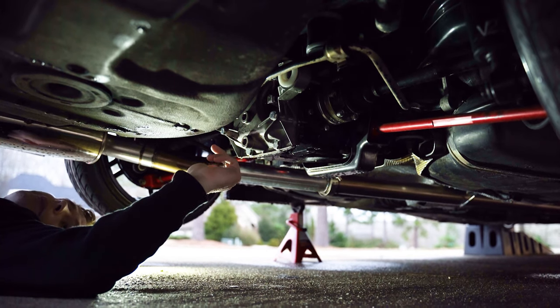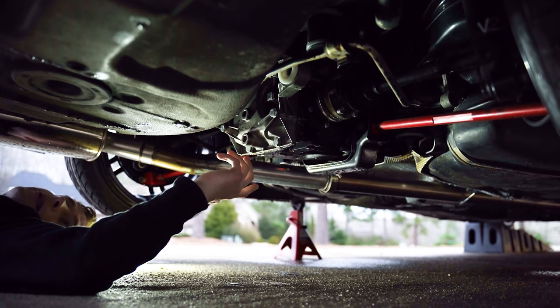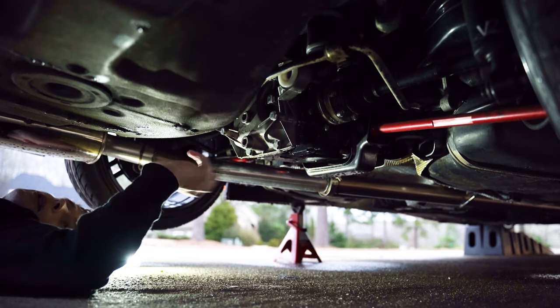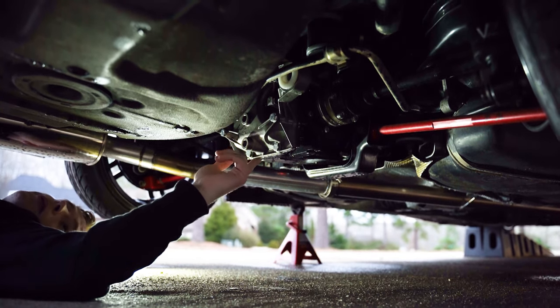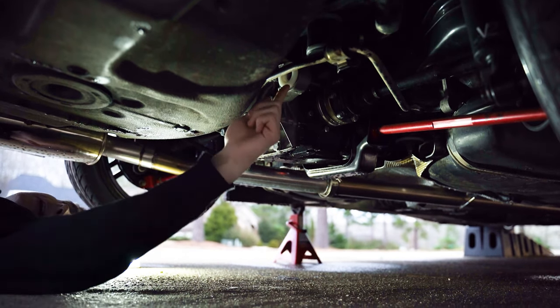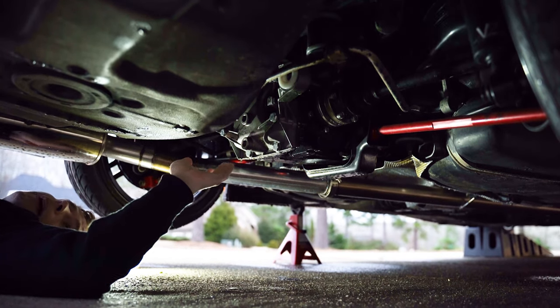This differential was made by my good friend Dante Bianchini, the anti-bimmer on Instagram is what you might know him as. It's a 315, and it's not just a 315 straight out of another car into mine. This has been opened up. Two clutches have been replaced with three Racing Diffs clutches. It's got Condor Speed Shop ear mounts on each side, all fresh hardware, new seals,